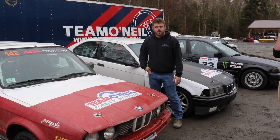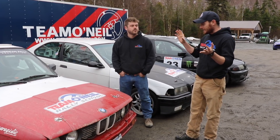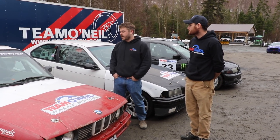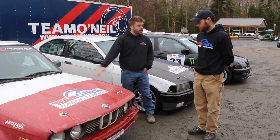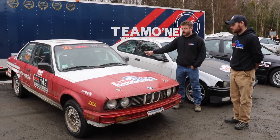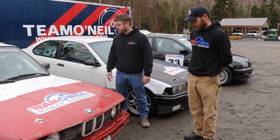If I were shopping for one of these, I would find 318s, 325s, ESs, ISs, and IXs. You wouldn't really want an IX — I wouldn't recommend it for rallying. Those parts are very scarce and very fragile on the four-wheel drive IXs. This is an IS, so that means it has a two and a half liter motor, the higher compression motor, somewhere around 170 horsepower. The IS was really a dress-up thing, but it guaranteed you got a limited slip diff from the factory. With older BMWs, you can get a limited slip diff from the factory — you don't have to buy a Quaife or spend $3,000 to get two-wheel drive instead of one-wheel drive.